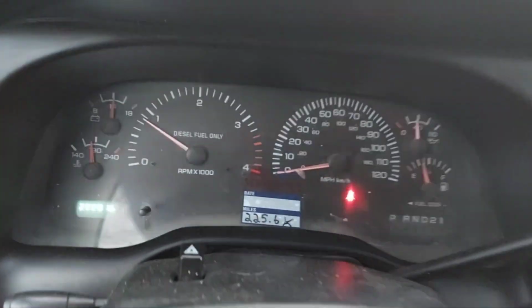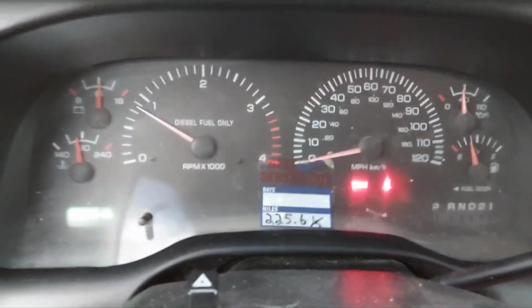So I'm gonna go ahead and put my brake. That's my parking brake. So yeah, it looks like it's all good. So I hope this helps some of y'all out in some way, if y'all have this same kind of truck and it's doing the weird pedal feedback, pushback thing, and your ABS light's on, and your parking brake light's coming on and stuff like that. So I got real lucky. I remembered that I smashed that sensor up pretty bad when I was doing the front end work, and luckily I didn't have to go throwing a bunch of parts at it before I figured out what it was. So it just took mine away, so hopefully it'll take yours away too.